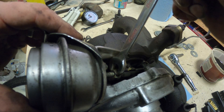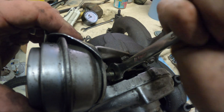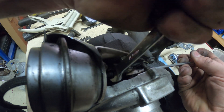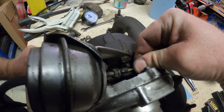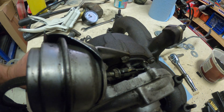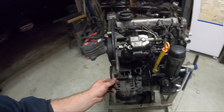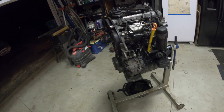It may actually run fine because this is a turbo that's happy at higher boost and I wasn't running it there — I was holding it back to 18 psi — so it may be that it was over-boosting because I was unnecessarily trying to keep it too low. Once the car starts and runs, we'll drive it around with the old tune and then get a new one on it. I'm satisfied with that — we'll leave it like this for the night, do some cleanup tomorrow, pick up a lawnmower to mess with. It's going to take time but it's going to be fine.